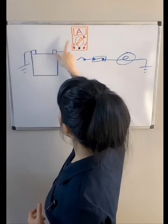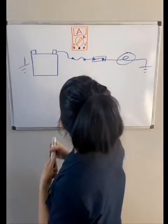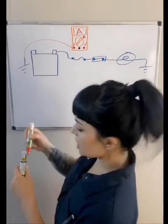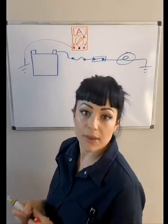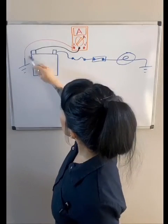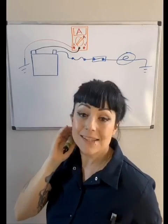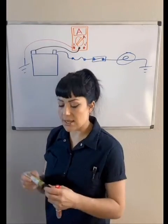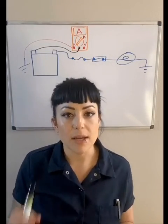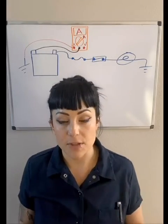We disconnect the battery cable and hook the meter in series. One lead goes to the chassis ground and cable, while the other lead goes to the actual terminal on the battery, forcing current flow through the meter back to the battery — that is in series. The problem with that test is it measures current flow for the whole car, so if you get too high a reading you keep pulling fuses until the reading drops to identify the faulty circuit.